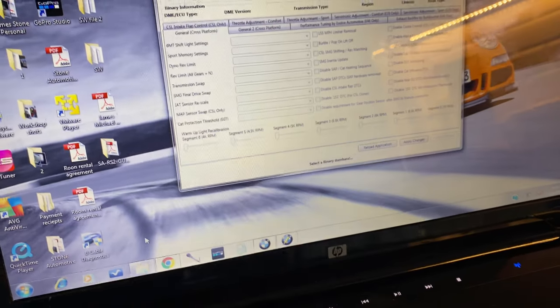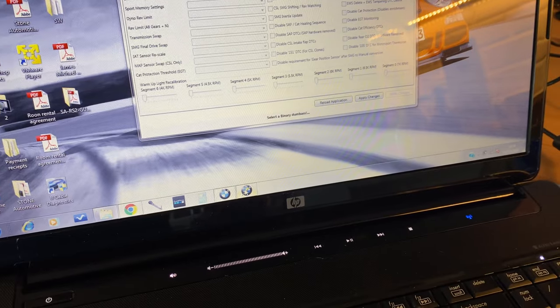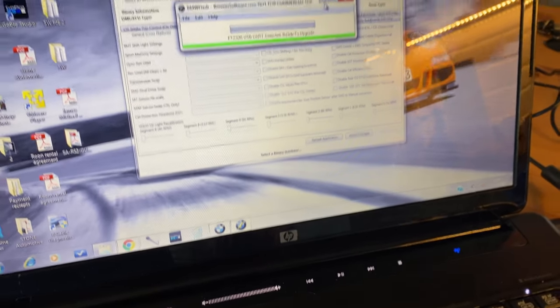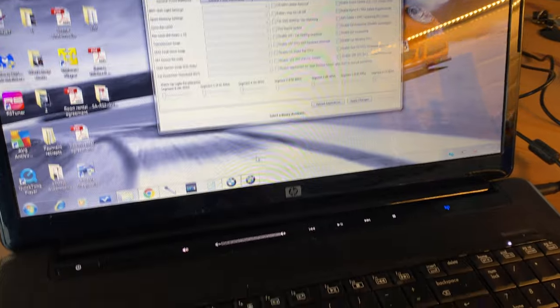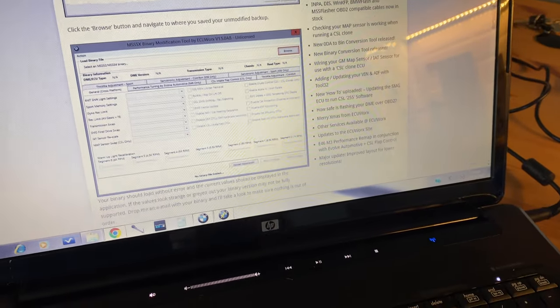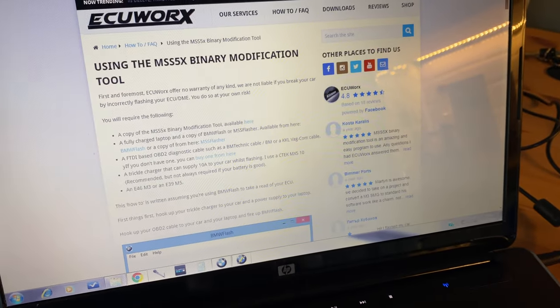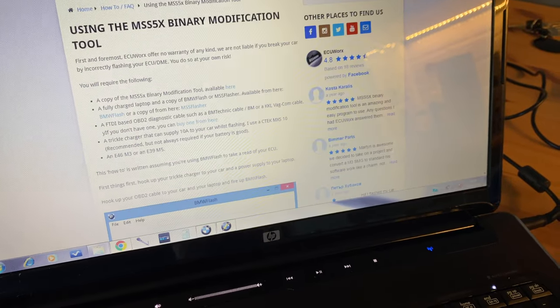So as we've got the IAT sensor rescale, which we're gonna do, I'm gonna go out with BMW Flash and do a read on the car. And what I will do is just quickly show you, this is from the ECU Works website. It's just a full step-by-step, which I'll link in the description. And as I say, I've no affiliation with the company, but it looks like they're gonna be the option to get me running the car properly. So we'll go and get a read now.